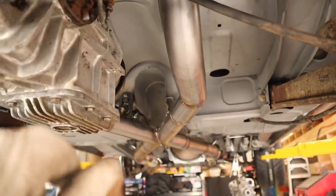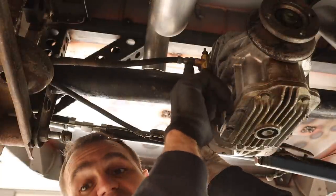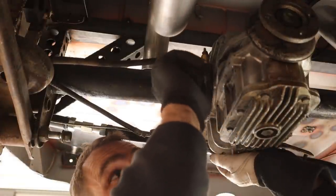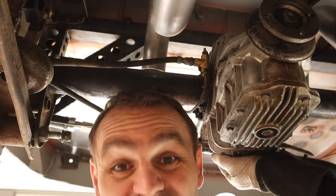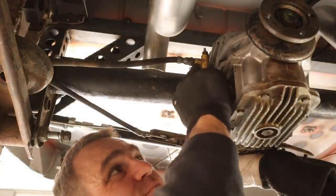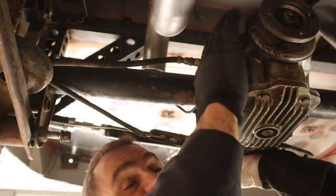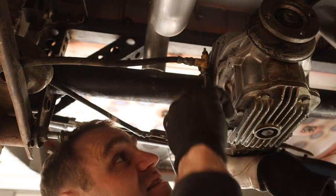It's time to do the rear brake circuit. In the rear, this is where the flex line comes out of the diff from the factory. The issue is that now I've put my exhaust in, when the diff is at full travel up the flex line is touching the exhaust - brake line on hot exhaust is not a good idea. What I'm going to do is take this bracket off and make a bracket to turn it around 90 degrees, facing forward towards the front of the car, so the flex line is not going to interfere. Let's do that.